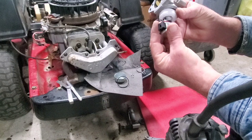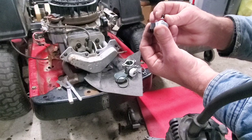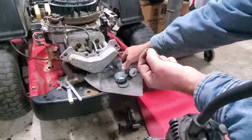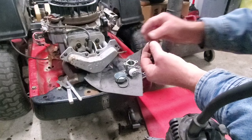What happens when this thing gets hot — mainly on these with the rubber tips — they get really loose, it just pops right off. What will happen is the solenoid will still be open because it's running, and the reason it shuts off is this gets sucked up into the main jet and shuts your fuel off.